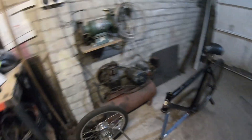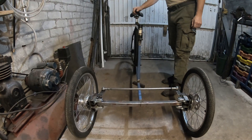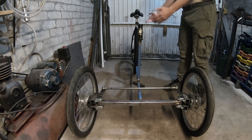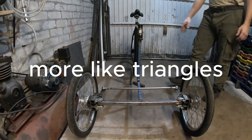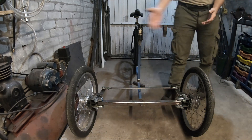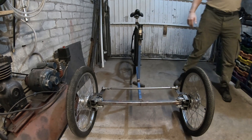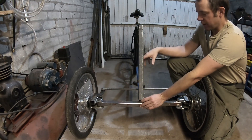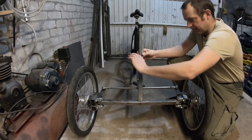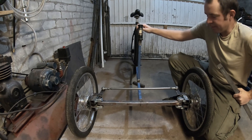It's not ideal because there is quite a lot of flex in the frame. Ordinarily a bike would just be the two diamond shapes, and that's strong as houses — tiny bit of flex at the bottom bracket, but it's negligible unless you're an athlete. With putting the axle on the front, it's giving it an extra pivot point, so we've got it flexing like that. What I'm going to do is put a brace in the header, and that'll give it even more strength. Then I'll go from this brace down to the axles with two more braces, and that should get rid of the crazy flex in the frame.